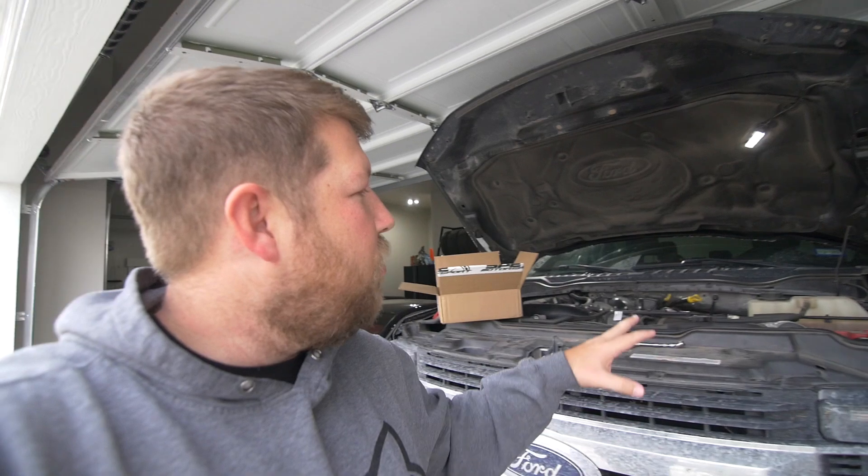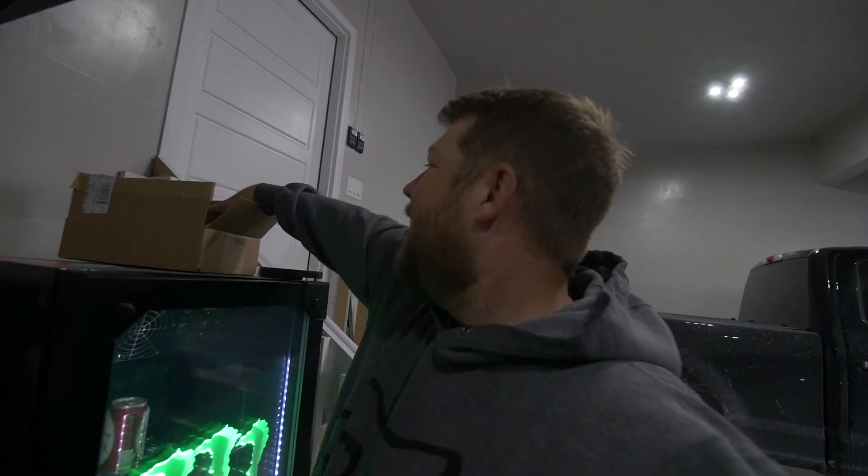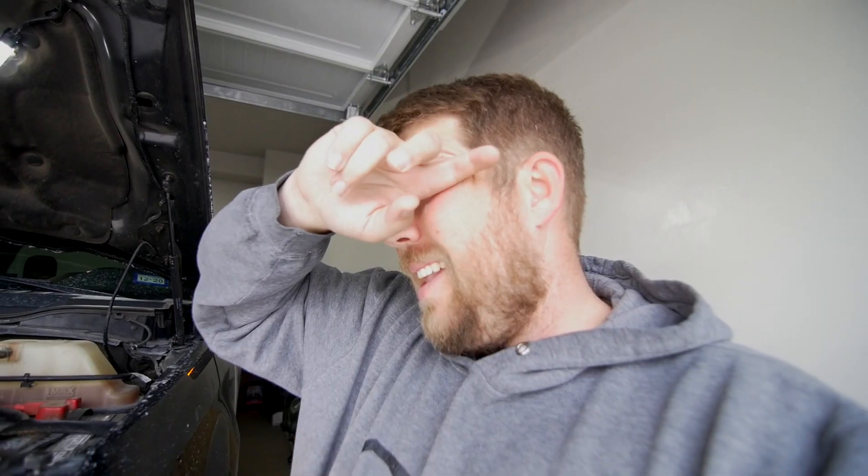This is their internal catch can kit and it's going to remove our CCV filter. I purchased a new filter, but come to find out they changed the filters in 2017. So this old style of filter no longer works — hopefully I can get a return on it. The one in there now doesn't have those same filter pods anymore; it's a different style. I'm at 82,000 miles now and they recommend changing that filter out before you hit 82,000 miles.